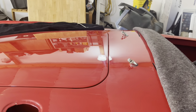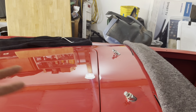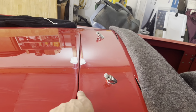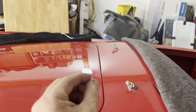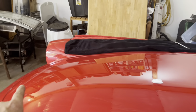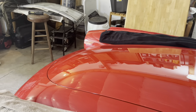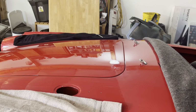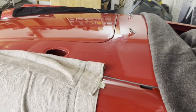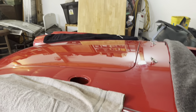And I have seen some cars where you just really struggle to get it, where I've had customers say, can you make this fit better? Where they're rubbing here, but it's such a little difference. You can't move it enough forward to get any real clearance there without it wanting to scrape up here. That's how a lot of cars are. But you got to remember, these things were largely handmade, and there's a lot of variances from car to car. Like actually, you usually can't take a fender off of one car and put it on another and have it be the same length.